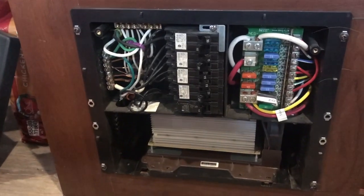We're going to show you exactly what is what: the 12-volt side, the 120-volt side, and the battery charger, and how they're tied together. That battery power distribution center is nothing more than a fancy battery charger — that is all it is. So if it goes out, get a battery charger, put it on your battery, and plug it in. That's all you have to do to get your 12-volt system back up and running.